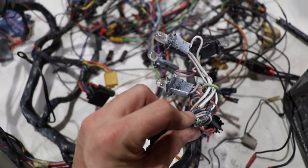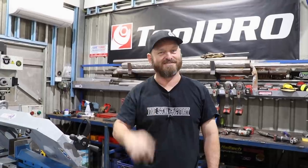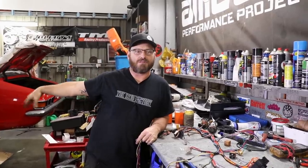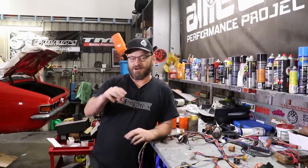That's the cluster, but it doesn't matter because it's not having that — there are no dash lights at all, it's just going to have an IC7 so it doesn't need any of that junk. We've made a pretty big dent in the wiring — all the engine management stuff's in there ready to go. Apart from the transmission control, which I've done most of, but I just got to make a resistor ladder — look it up if you want to know what that is. But that's a little separate harness anyway — it's all terminated, ready to plug in.